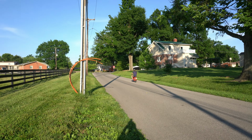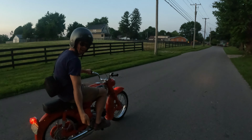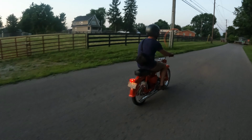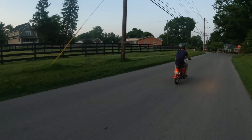While the bike may seem to run fine upon startup, a charging system that is not performing properly will manifest itself later on in the form of slower turn signals, fainter horn, dimming headlights, diminishing or erratic engine performance, and ultimately, in many cases, a non-running bike incapable of jumping energy across the spark plug's gap, leaving its rider frustrated and stranded. While there are several possible causes to a lack of performance in an old motorcycle's charging system, let's take a look at a common one.